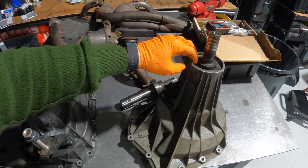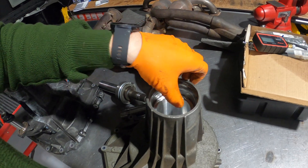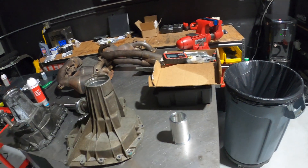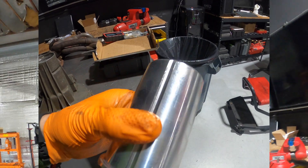With our seal kits, we include new seals for this. We are now adding this aluminum piece upon request, which we highly recommend for any FF or early California. This will prevent an issue from developing into something bigger that Getrag and Ferrari are just not supporting you with. They aren't cheap — it costs a lot to get them made — but it's way cheaper than a new front case, and it will give your FF or early California DCT a longer life. The good thing is you can install these spacers without removing the transmission.